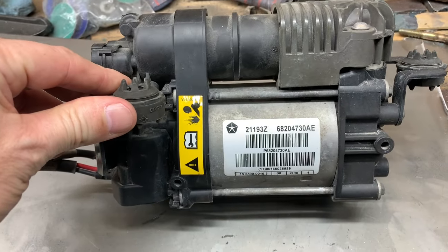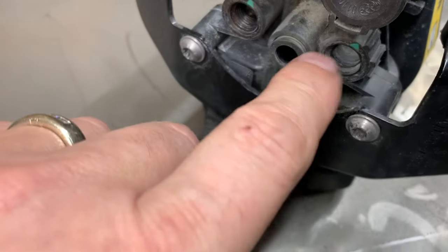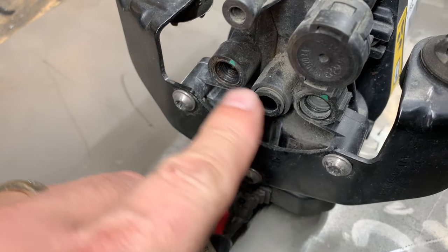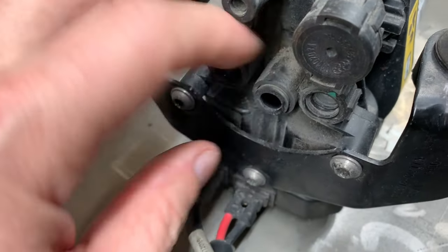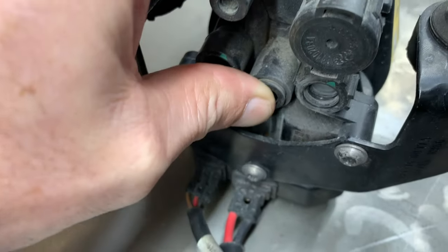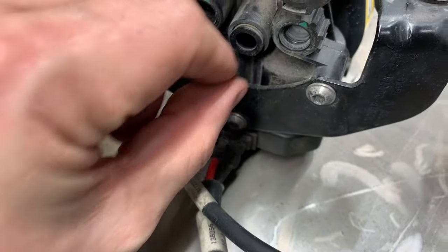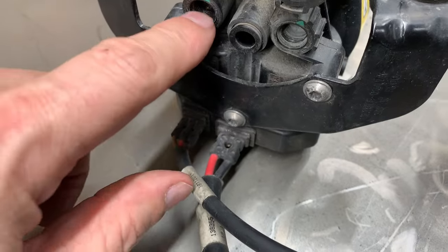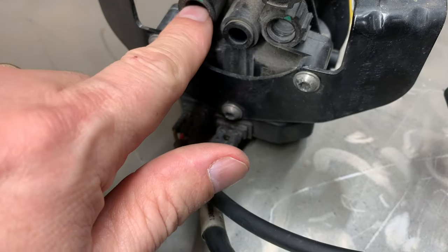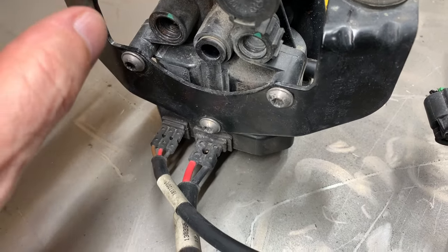This is what a pump looks like. On this side you have an airline that goes here, just like that brass fitting I showed you. This one goes to just like an air vent, and there's an elbow on here. To take that off you've got to push this in, then you can pull the elbow out. When you reseat it, you push it in and pull the whole thing out and it locks. The replacement pump I got had brass fittings where you just push the line in. I trimmed off the lines just a little bit to get the dented part off so nothing was crimped.